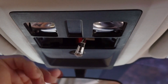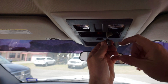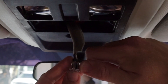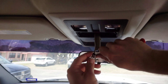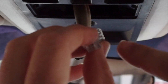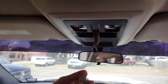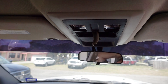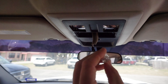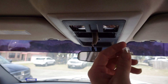Once you get that LED loose, the wiring harness is kind of short for it, but this is the actual LED - this is the bulb you're wanting out. Once you get that thing brought down, you've got the same style clip. You're just gonna pop that little clip out. I remember on mine it's not only a clip holding it, but it's also like heat or glue that holds it together, so you've got to kind of really pry on it. So now that we've got this out, we're no longer gonna be using this terminal. What we're gonna do is actually take a drill bit through the back side right here and drill through it to get to this lens. That way we keep the factory light distribution from this LED. We're gonna be changing this one to red. Hopefully later on down the road I might come up with an LED that can do an RGB setup. Let's go over to the vise and drill this guy out.